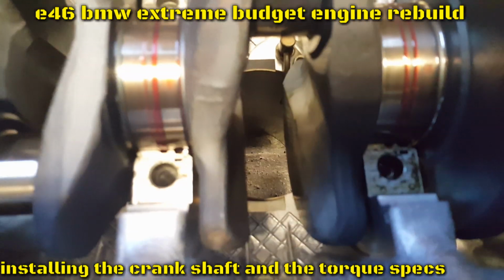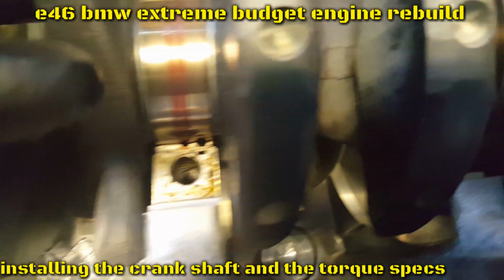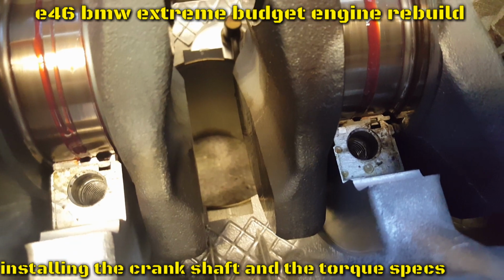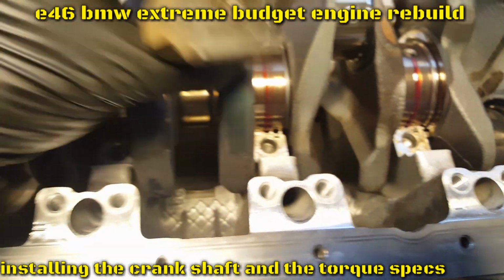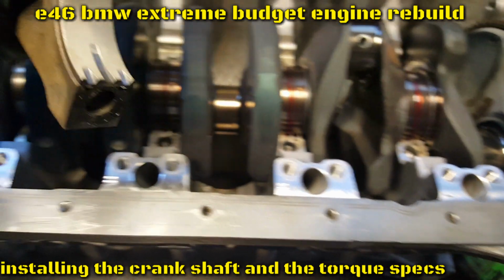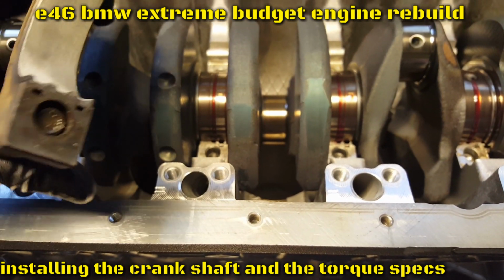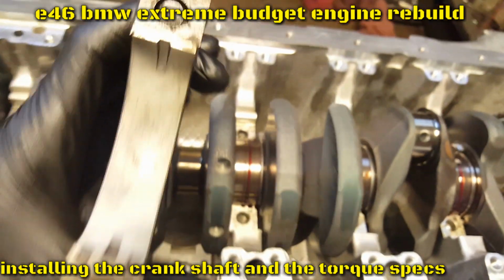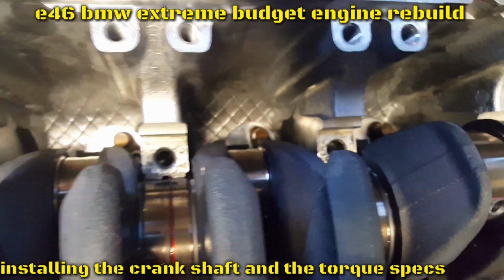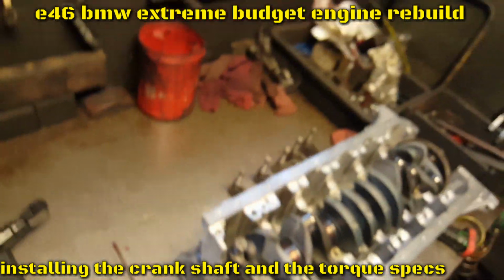Okay, so you guys see the double grooves in there. That one has 2 grooves. That one has 2 grooves. That one has 2 grooves. Another 2 grooves in there, and then here. So this is your main bearing. You see how the grooves match in here, like that. Boom. This one has only 1, which is right in the middle. And you can see that one right there, right in the middle. So you get me, right? It has to be matching 2 and 2.